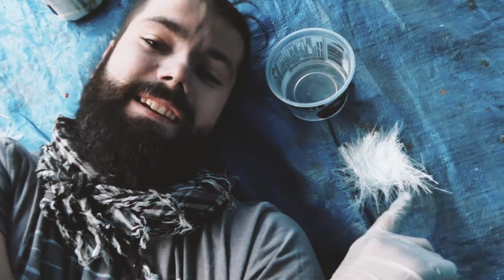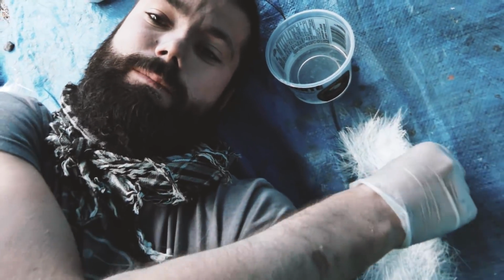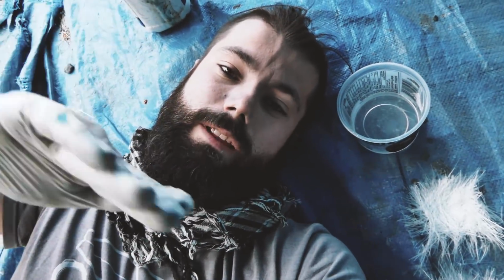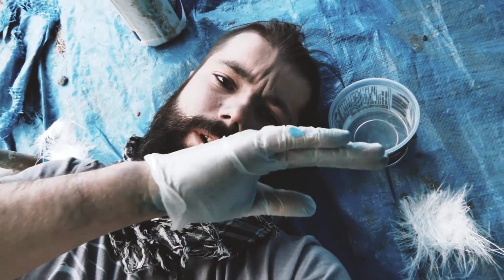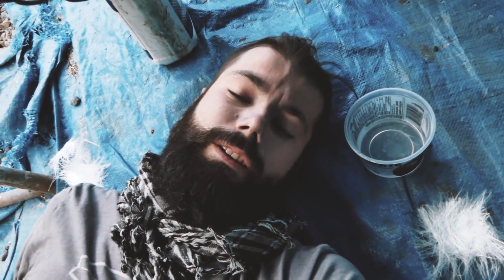And then, as you can see here, I've got these little pieces of fiberglass, a large one and a small one, and that's just to help me fill in. So we got a small one and then the large one, and then we'll get it nice and flush and flat with the rest of it, and epoxy over the whole thing. Let's get to it.